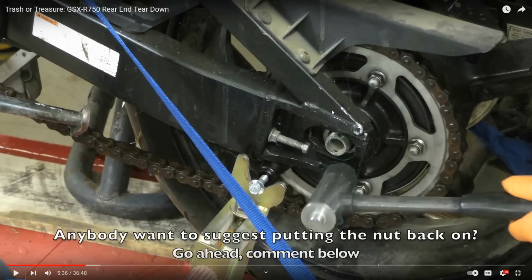And you just need to... This is why sometimes it's good to, if you've got a bit of a frozen fastener, like a proper nut and bolt kind of thing, give it a bit of a shock. You just shock it a bit. It just opens the gaps between things. As the sound waves move up and down, it basically frees stuff up a bit, and it just helps you get it loose.